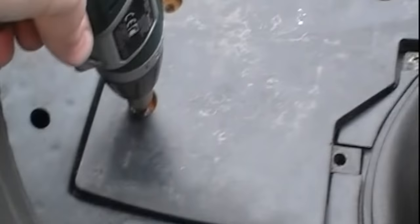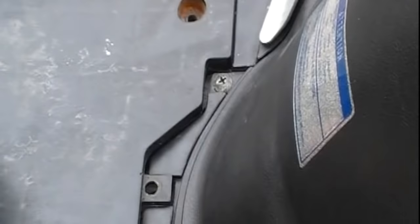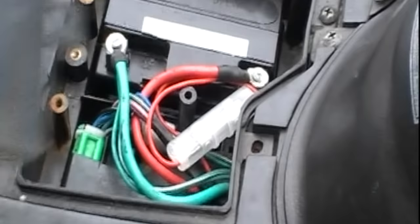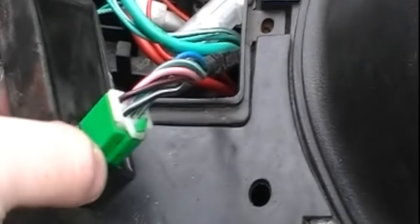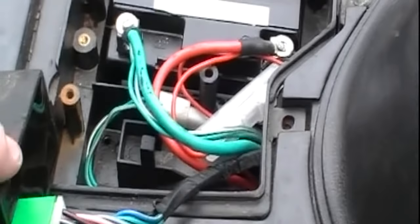There you go — you get access to your panel. This thing here is your CDI unit. It tells the bike all the information it needs — like when to fire the spark. But if you can see this wire here, this pink one right here — hopefully it gets into focus — there we go. So this pink wire is what we need.